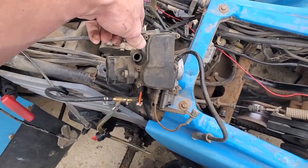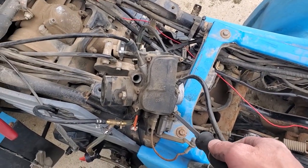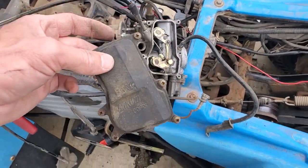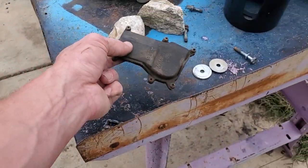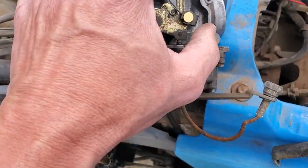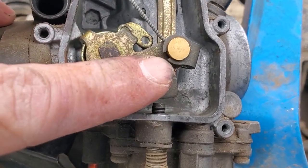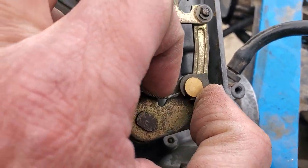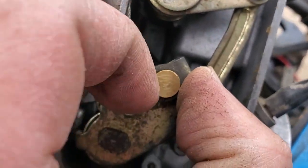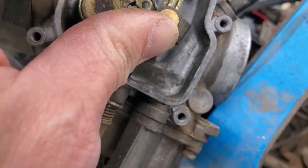Got it here on the side — we're going to do this side plate, it's going to be six Phillips screws. Okay, side plate's off. Set that somewhere safe. We're going to do one of these tricks where we flip it up — here's the way out. You can't bend it there, but if you flip it up you'll have the slack you need. Just bend the wire.